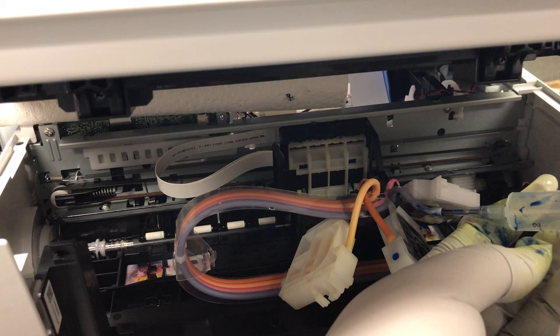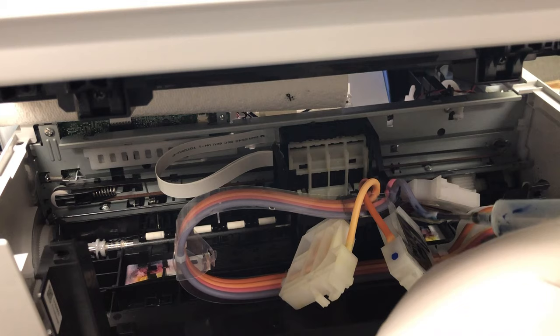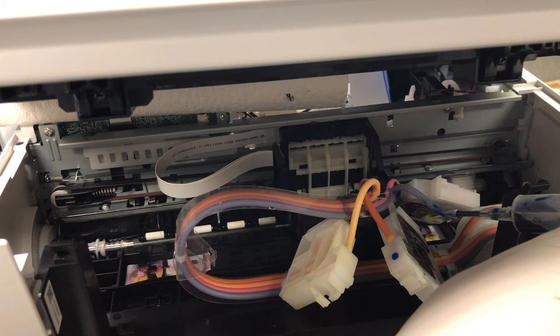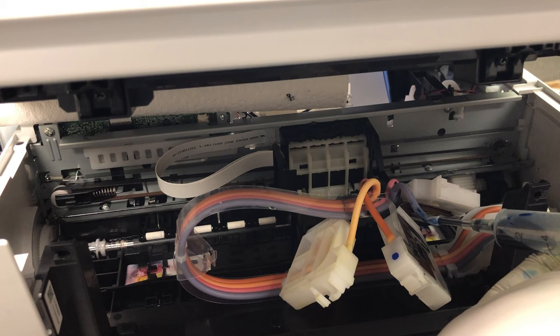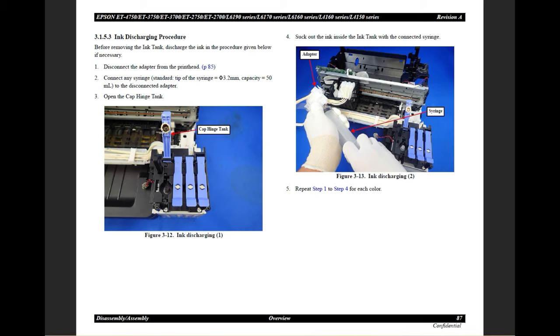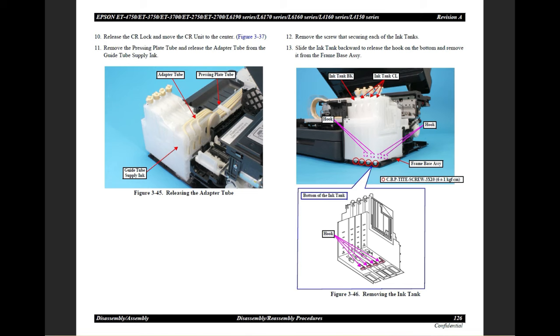You can see how we did it: we start with the printhead, then we troubleshoot backwards. We test the damper, then we test the tube. What you can do next is remove both ends of the tube and make sure there's nothing blocking it, then work backwards to the tank. Also, when you do this, make sure you lift up the refill plug first — open it and then you'll discharge the ink this way.